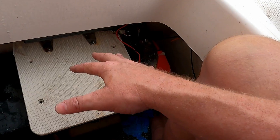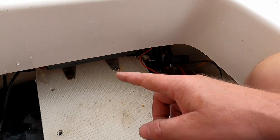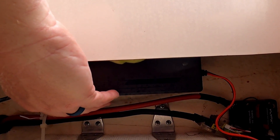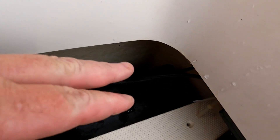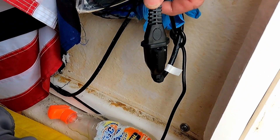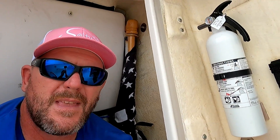This battery has been running for just about two years. I have a lithium charger mounted underneath — you have to have a lithium charger, you can't charge this with just any charger. I have it mounted under there with gator clips permanently attached. The wires run back up and over to an AC plug which goes through the wall to the outside, so when I get back to storage I can just plug in AC and it charges. A previous charger's gator clips eventually rusted out, so I had to buy a new one — these lithium chargers are about $45 and they work great.